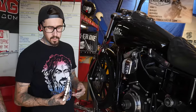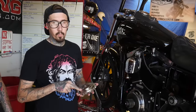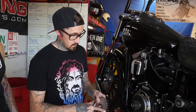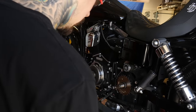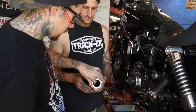Now, while this is up, we're just going to go ahead and throw on the front sprocket. This will come with your kit that you bought from us or whomever else — it just slips right on, like so. Now we'll go ahead and put some red Loctite on the nut.